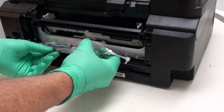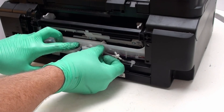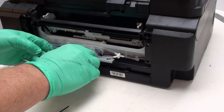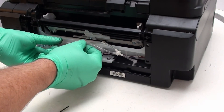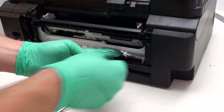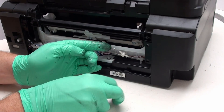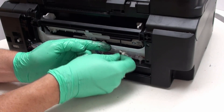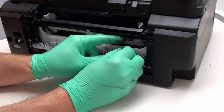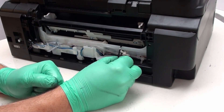What I'm going to do now is make sure that everything routes properly through the printer so it doesn't cause any problems. You want to stop these tubes from getting pushed up against this — it causes no end of problems. They need to go over the top like this to avoid falling behind the panel and getting crimped. The way to resolve this is to use the nylon tie that comes with your part, going through a hole just here, which allows you to stretch everything out and hold everything in position. By putting that there and pulling it tight, that is going to stretch everything out and hold everything in position.